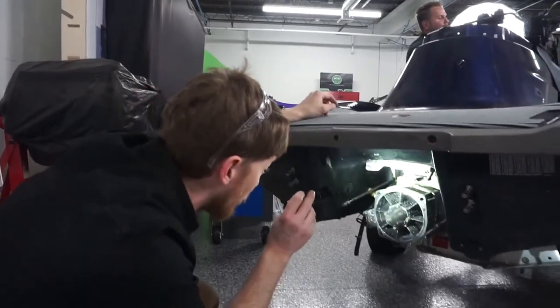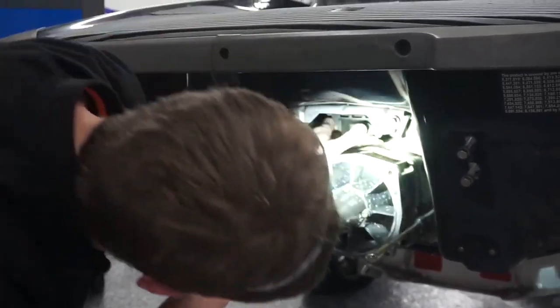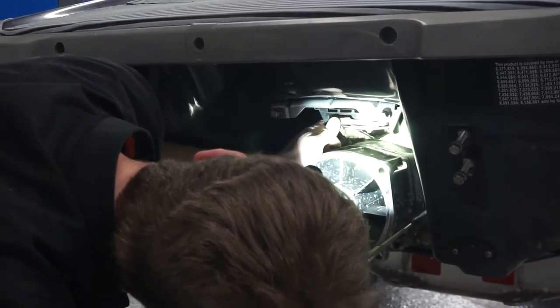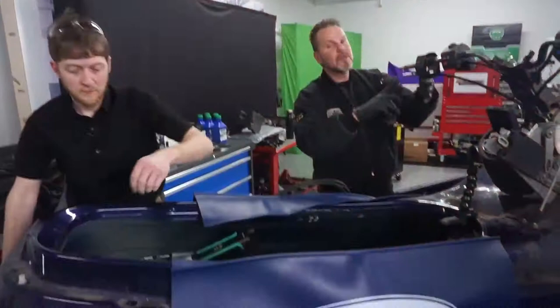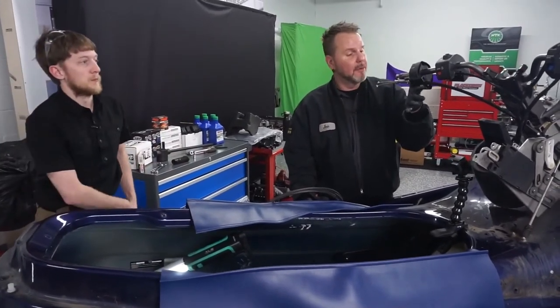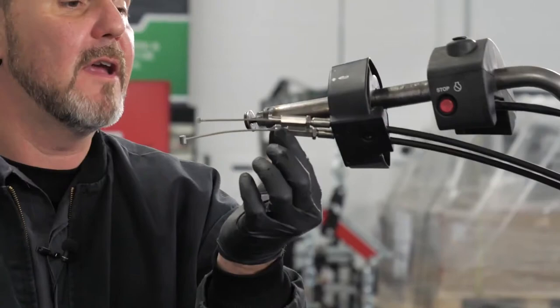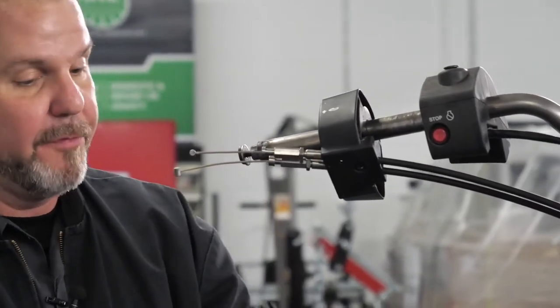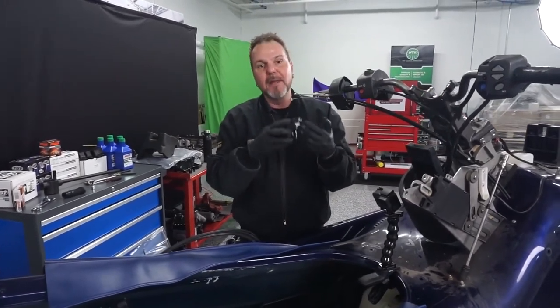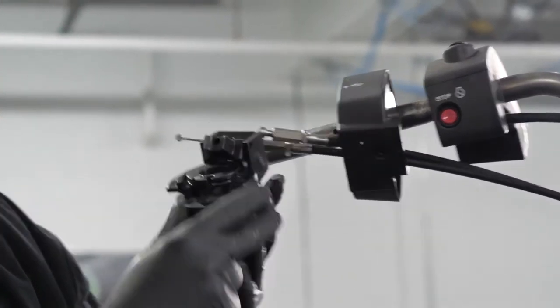It's a lot easier to do this one before connecting up front. I had to rotate it all the way over to get the cable through, but that was pretty easy. One of these cables provides tilt up, one provides tilt down for your trim. You may have noticed I didn't mark the old cables upon removal — the cables have collets that are two different sizes and will only fit one way, so you know which is which without marking. They can only go in one way, which is a real time saver.